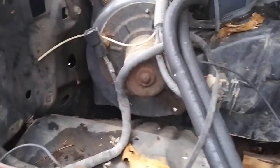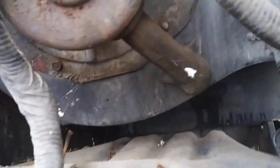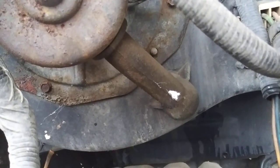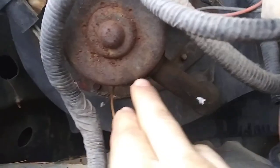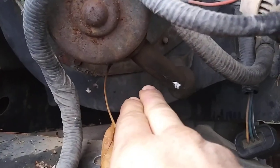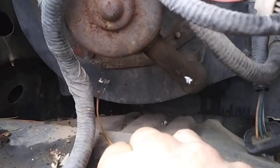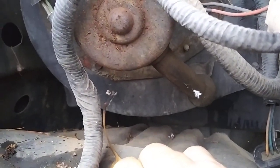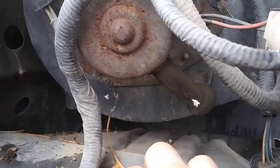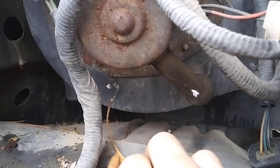Here's our 89, and this one actually does have the heater tube on it. That hole on the side is where this tube connects. All this does, plain and simple, is keep the blower motor from burning up — it basically self-cools itself. That's all that tube is for.